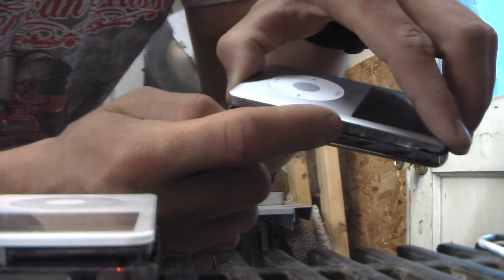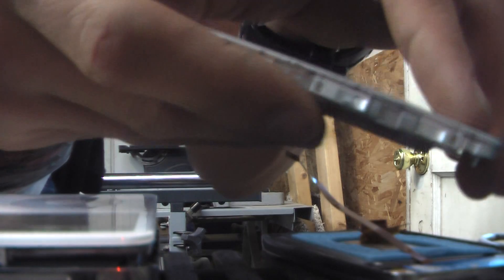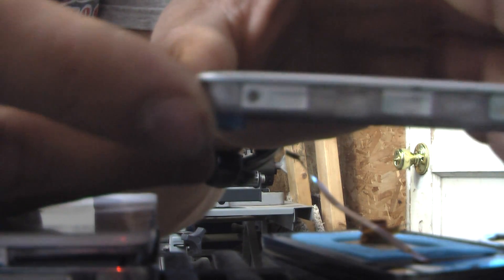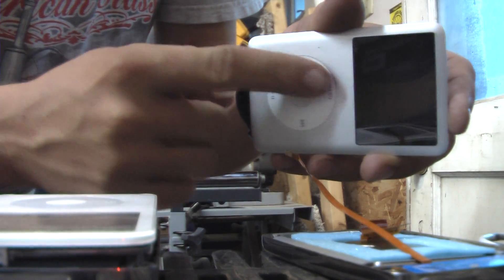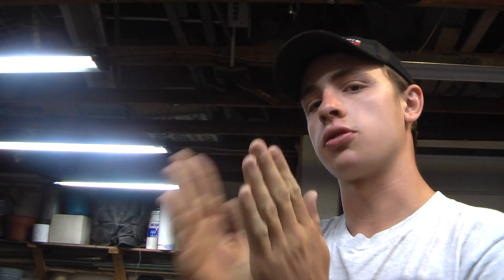Basically I have to pry these two pieces apart — be very careful not to scratch it or damage it. These tiny little screws along the side here come out, and that removes this front piece so you can get to these buttons and the screen cover. So like I said, they can be a little bit difficult to work on, especially when trying to get those two pieces apart, but once you've got it apart it's really simple on the inside. For those of you who maybe have an iPod that needs a little bit of work, or for those of you who just like to see stuff taken apart, hope you enjoyed this. See you guys in the next video — peace!